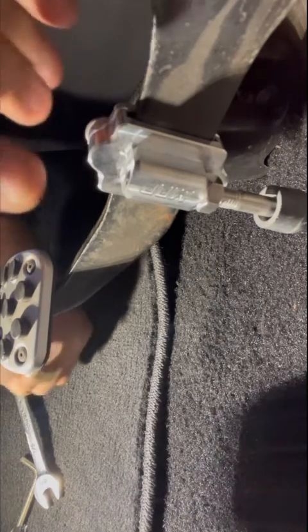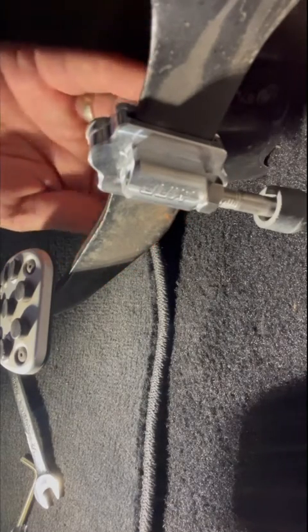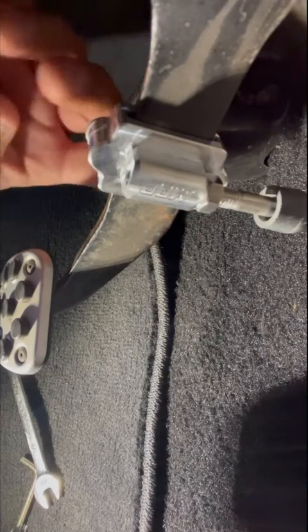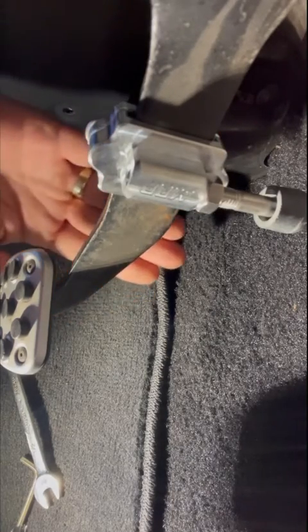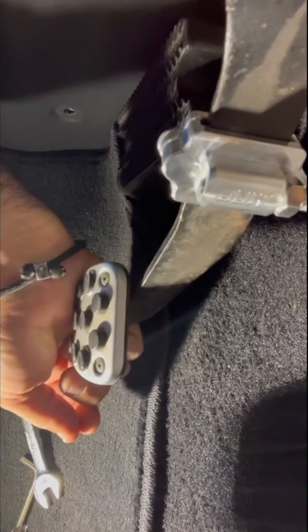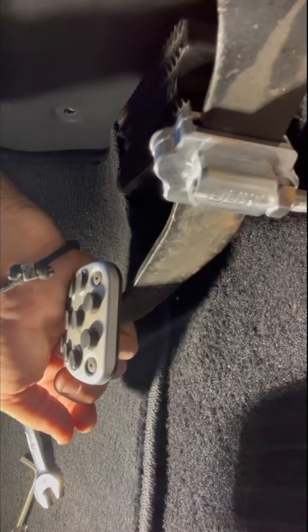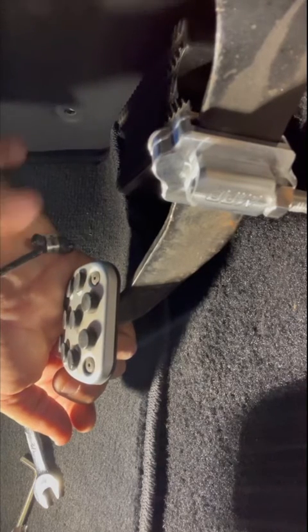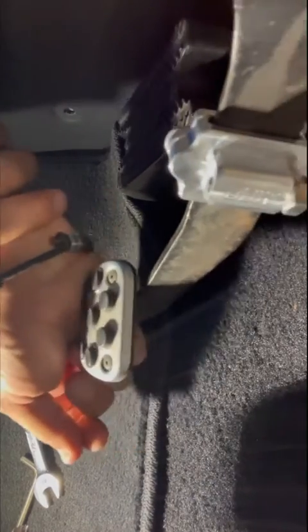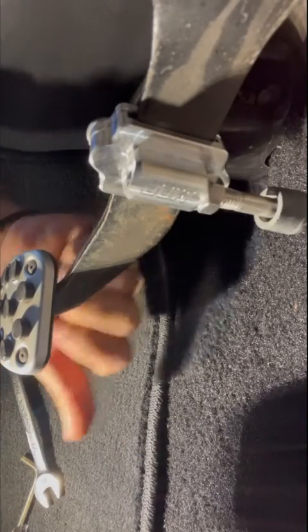This product was designed because a lot of people were damaging the diaphragm, clutch master slave cylinder, throw-out bearing, and even the thrust washer in the engine. To recap: push the pedal down to the point where you can go into gear — or if you have a twin-disc and hear the floaters tingling, that's your disengagement point. From there, you should travel no more than one inch before hitting the firewall. It's a very simple installation — any questions, just ask.